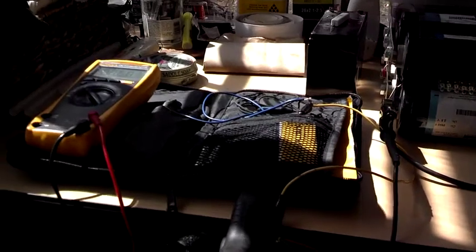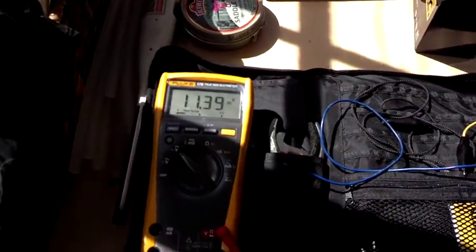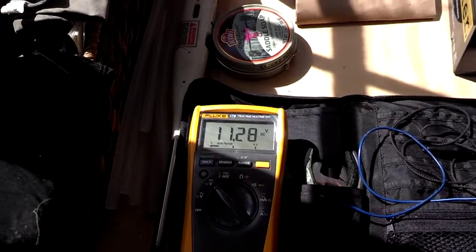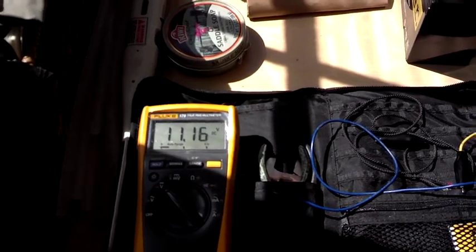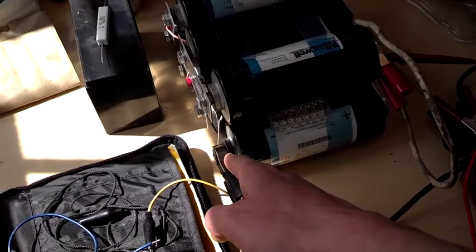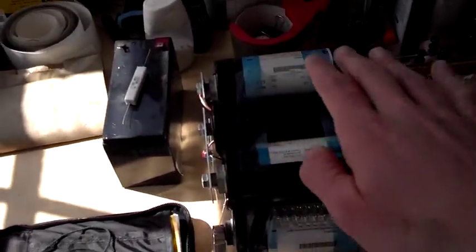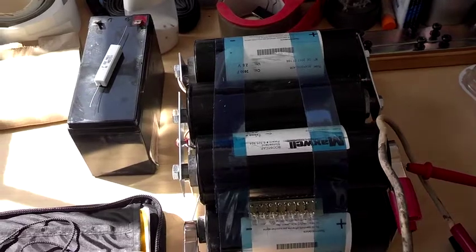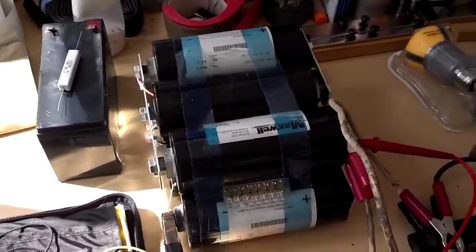The next test — I just measured the bank that is in the truck right now, our big Dodge. It will be wired in parallel with one of the existing batteries. We have two batteries in that big beast. I will need to get one or zero gauge wire and then may build a plastic or wood box with some inner tube rubber lining for vibration, and maybe a strap to mount it down with some kind of handle to lift it out.